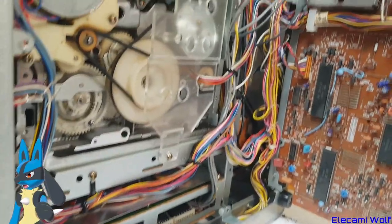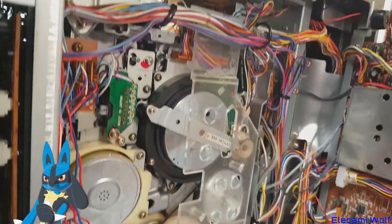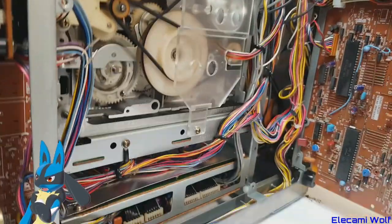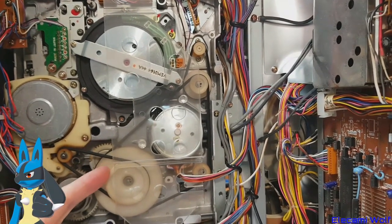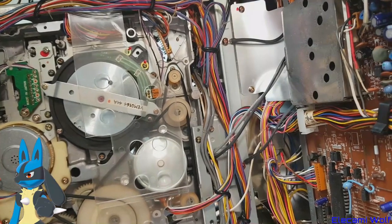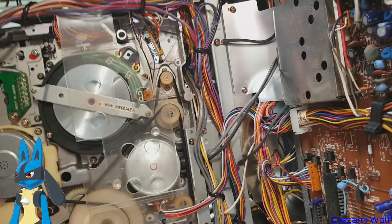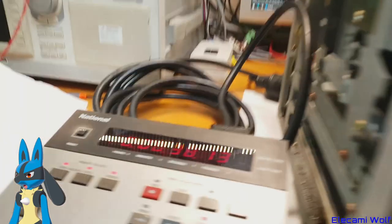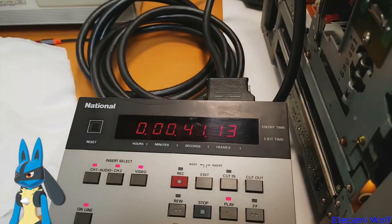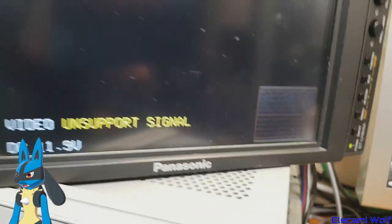We've got lots of good stuff going on in here. If we put it in play — I'm guessing something to do with this, because that's all the loading motor stuff. Power it up. Got into play mode. The display says 'unsupported signal', but you can see it's playing there. On the waveform monitor there's just some noise — maybe the heads are fully clogged or it's got some other problem.